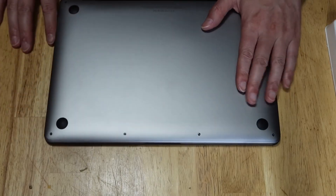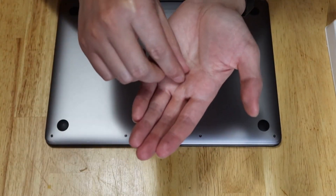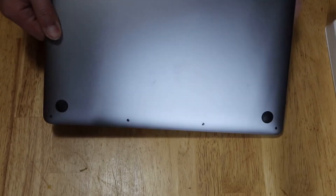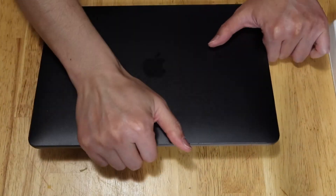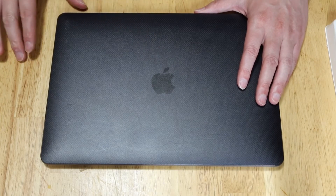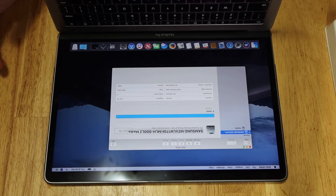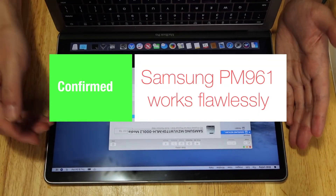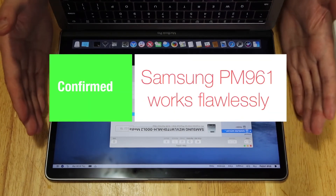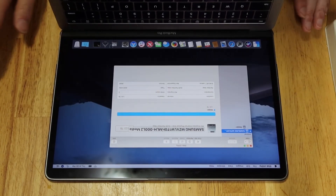So today I tried to solve two issues. First, by removing the two metal pieces I was able to set the NVMe SSD more flat, so there's no bulkiness on the bottom and the laptop can sit flat — which is good. Second and most importantly, the NVMe SSD can work flawlessly to support sleep and hibernation. As of today I cannot find any flaw with the third-party NVMe SSD. I will do more testing, but I'm very confident that the new SSD will work as flawlessly as the original Apple SSD. Thank you so much for watching, see you next time.